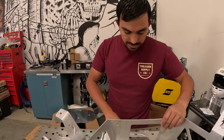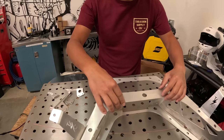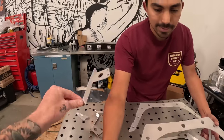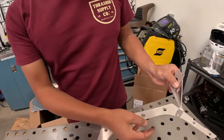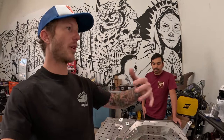New inner bag mounts — logo looks proper this time. We ran into some features where originally it was connecting here, but we realized the headlight needed more clearance. We're going to gusset and weld the top pieces, add the dimples, and then box it all in. We're also going to continue to rivet this on — I saw some Formula One cars at the Long Beach Grand Prix with this style. It's definitely a goal of ours to sell this piece eventually. You guys are witnessing firsthand what we go through with the R&D process — it requires weeks, sometimes months; sometimes we're working on a project for almost a year before we can actually produce it.